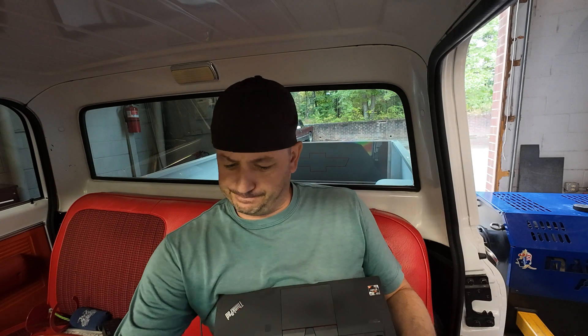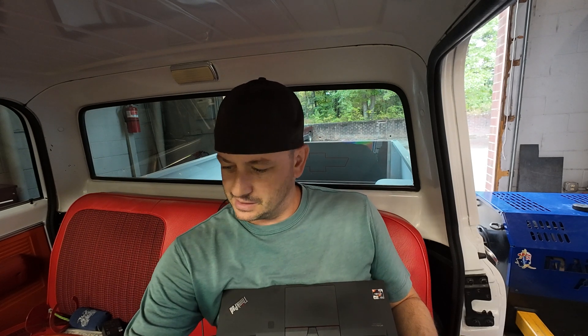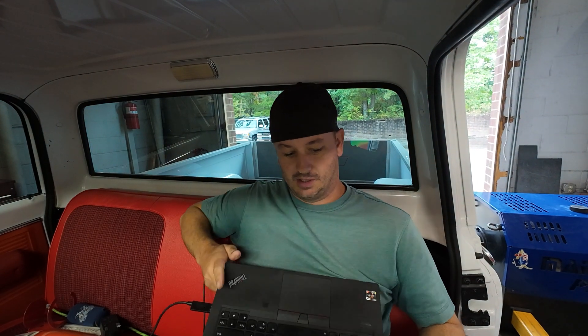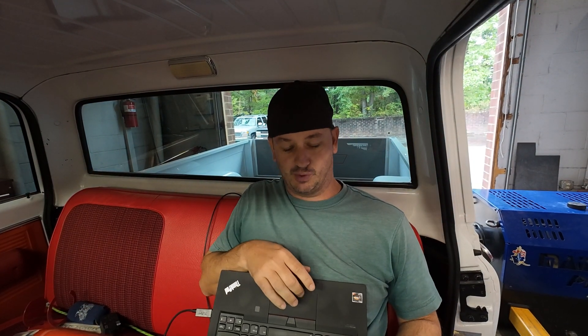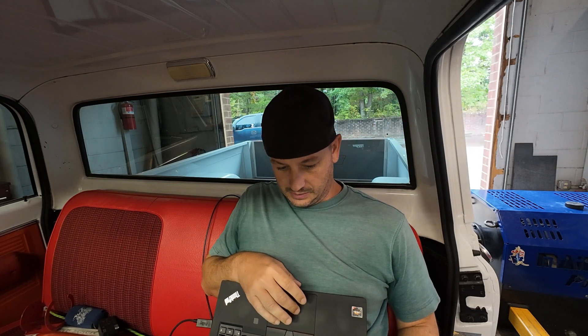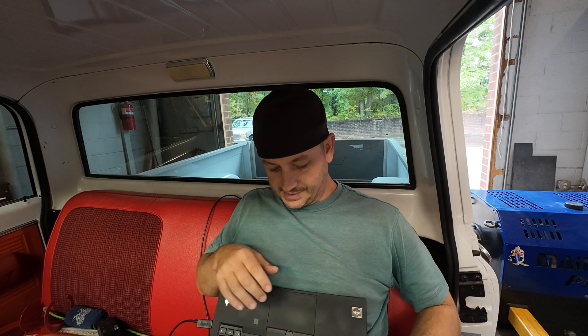I'm going to go sit at the table and make a new file. Let it up — what should be a pretty decent starting point. I suspect I probably have too much IAC park position in it, so probably going to have to come down on that. And since it looks like we're dealing with a fuel problem, I actually scaled the fuel table. You can see that one cell's white — essentially scaled this to where it's just flirting with maxing out the injector. I'd rather start overly rich than lean. Shot that into the ECU, cycled the key. Let's see if this IAC park is too much.